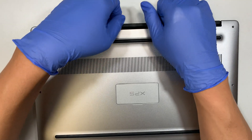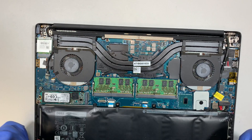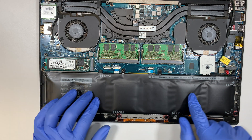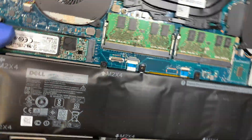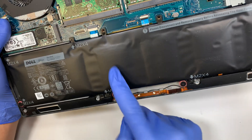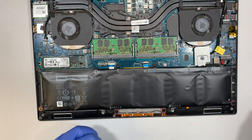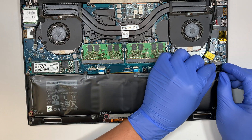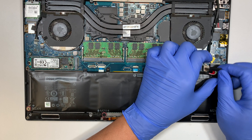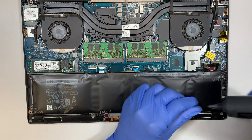Once you remove all the screws, you can start peeling the back plate. I'm just using my finger to tuck underneath and pull it off. Now you can see the battery has a lump on it — it looks swollen, like a little individual detergent pack that's swollen, pushing the touchpad from underneath. Let's disconnect the battery by pulling the connector down towards your body. There's no safety pin; it just slides in to install and slides out to remove. Now remove the Phillips screws holding the battery.